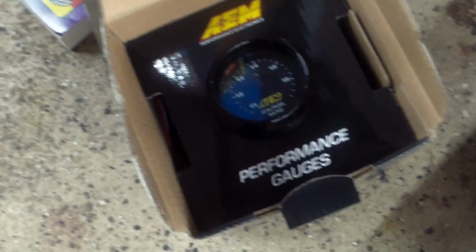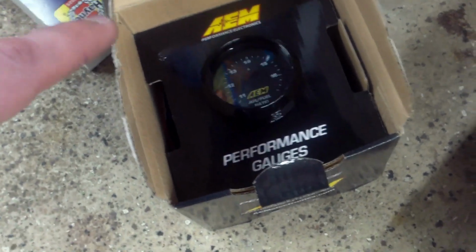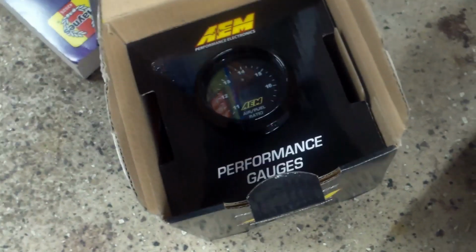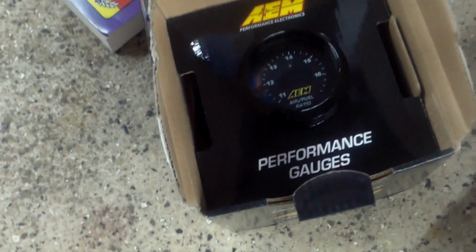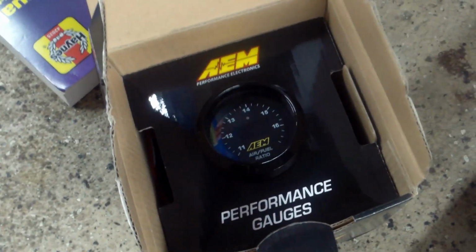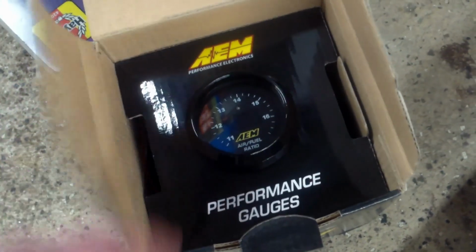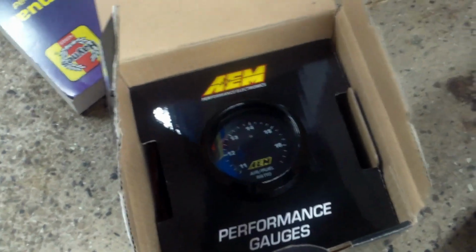We have our CX Racing 2-core radiator, so it'll be able to handle some heat. We are going to be data logging and tuning with this AEM UEGO 30-4110 wideband setup. Wasn't really needing a gauge, since you can set parameters in Hondata to have boost cut if there is a lean out situation. But now I have to figure out where I'm going to put the gauge in the car, and I'm going to try and keep it as stealthy as possible because this is supposed to be a sleeper build.